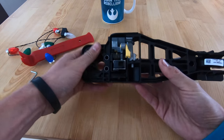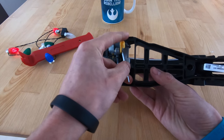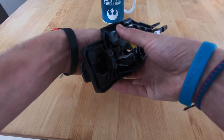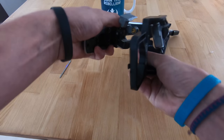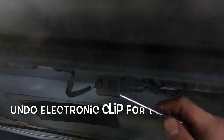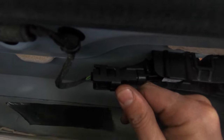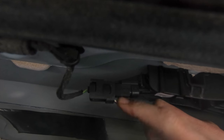So just to review that, guys. This is honestly the hardest part, at least it was for me: lining this up, getting my fingers in there, and then clipping that in and unclipping it. And then real quick, reverse: grab the top of this piece, push it down with your thumb and slide it out. Don't scuff your paint. Slide this into there to loosen it. You don't need two hands, though, again. You slide your screwdriver in there and then pull it apart.